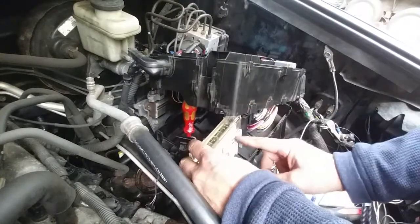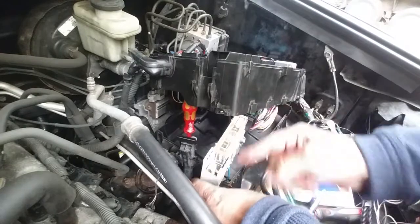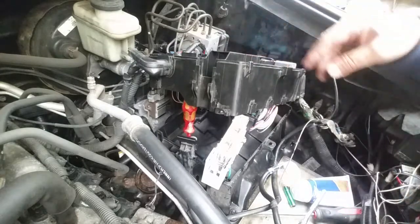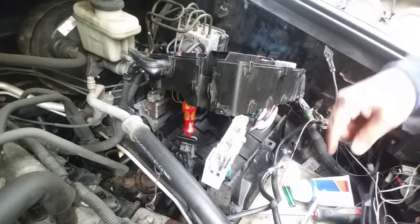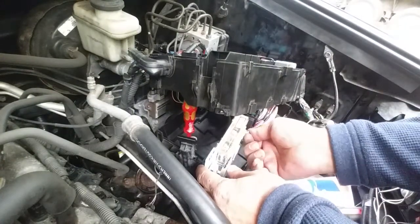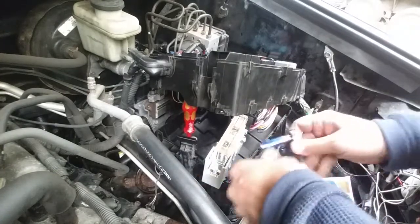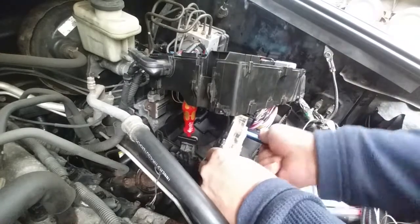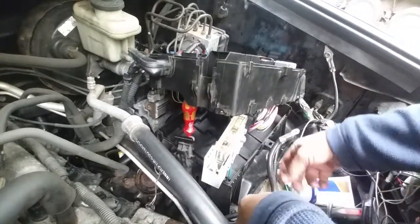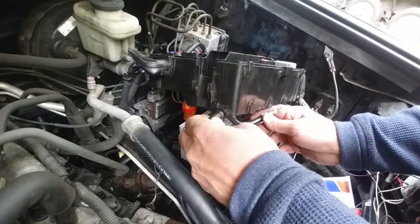It's clicked in and there's a screw here to make sure it doesn't come apart. That is all one piece all the way across and it's going to slide in from the bottom and click up to these fasteners — these clips. The tricky part is to attach the main fuse block to the smaller fuse block by sliding it from the top down. That tab connects the two and transfers power over to the smaller fuse box. Now we have the main battery cable.